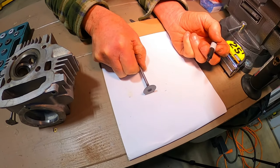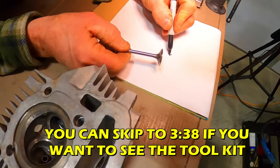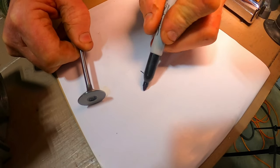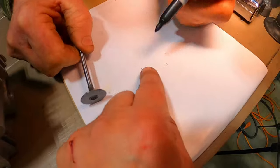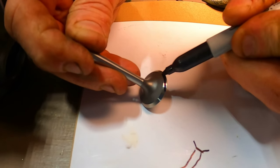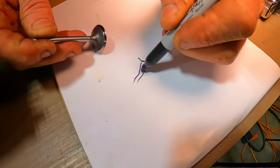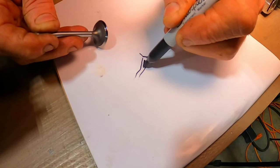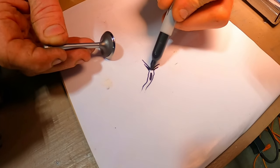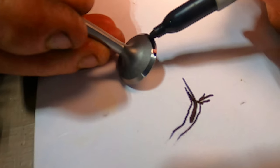You have a 45 degree angle where your valve seats. But the thing is, there are actually three angles for cutting a valve — you've got to have an inside angle and an outside angle so that the valve seats on there. When you're lapping, that's the surface it sits on, but you want a real thin contact area. You want shiny above and shiny below. You want your contact area of the valve roughly in the middle, so if the seat is too wide you have to cut the inside and outside down to make it narrower, so it fits the valve and hits kind of in the center.